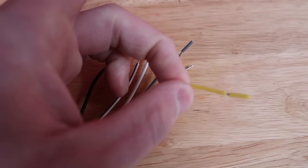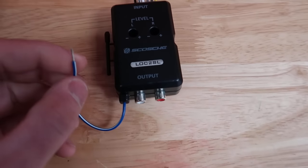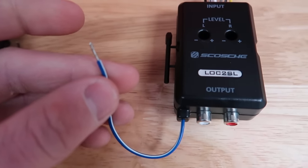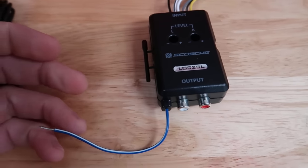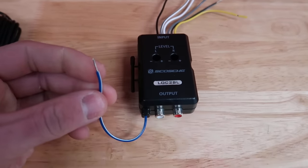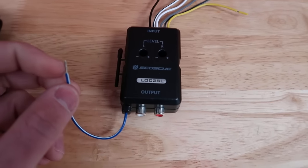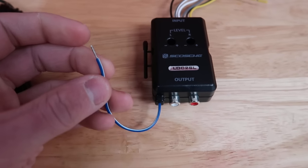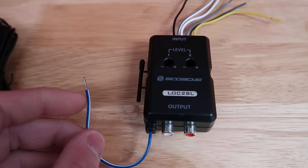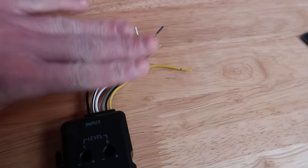Another great feature about this that a lot of people don't realize: whenever it hears sound coming out of your speakers, this turns on your amplifier. So it's not running your battery dead and on all the time. When you turn off your car, it'll turn it off. Normally you have to wire that in through the fuse box, which is kind of a pain. That's another really cool feature about this particular line-out converter because it has that built in. You'll plug this into the amp where normally your power wire would go, and this just tells your amp to turn on whenever you have sound coming through your speakers.